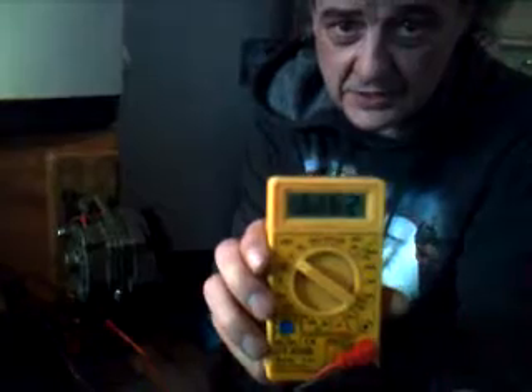I'm going to take these last two wires down here to connect to the battery — the positive and negative wires. I put the negative on the negative post and the positive on the positive post. And now what you see is the light bulb lights up. You can see over here that you have 11.65 volts on your battery. Your battery needs to be above 6 volts in order to start the alternator working. So I'm going to take my screw gun and put it into the middle of the alternator to spin it, since it has to be spinning at a certain speed in order to generate electricity.